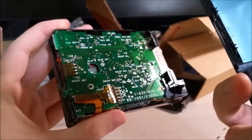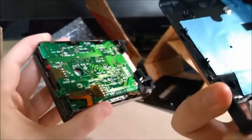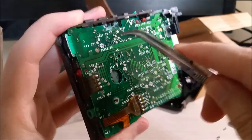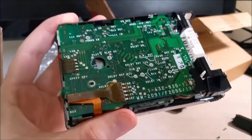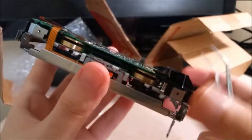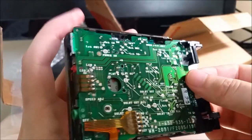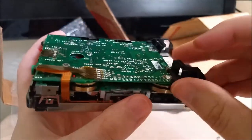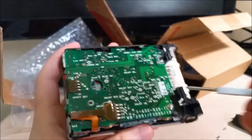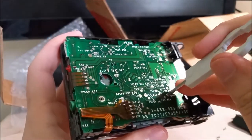That broken Dolby NR switch — the plastic's not broken on the fingers under there, and it looks like the switch is intact, actually. So maybe whoever was sticking it back together didn't locate the position of the switch correctly. That switch isn't broken, so that's a good sign that I don't have to replace that. Let's see maybe if we can get this board off. Hopefully I don't have to desolder everything, though that might be a possibility. There's a screw I can see right here. Sony has a very nice methodology where they put a double arrow pointing at any screw you need to remove to get to the next layer of the assembly.